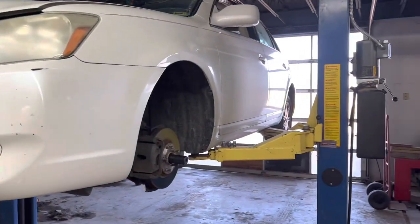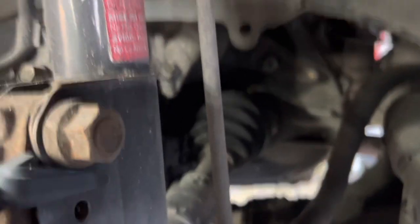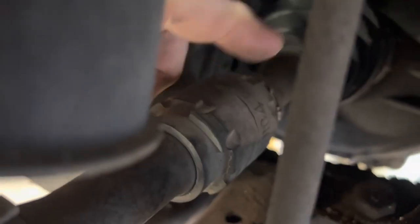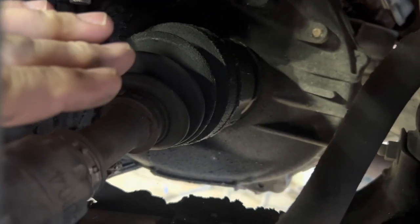What we got right now is a Toyota Avalon, and these half shafts right here are shot. This one is the good one — it clicks back and forth a little bit. But here is what really has me worried: underneath this vibration dampener, they like to rust out. Now since the inner joint has got a click in it, I decided we're going to go ahead and change that as a precautionary measure, because this one right here is shot. Shot bad.